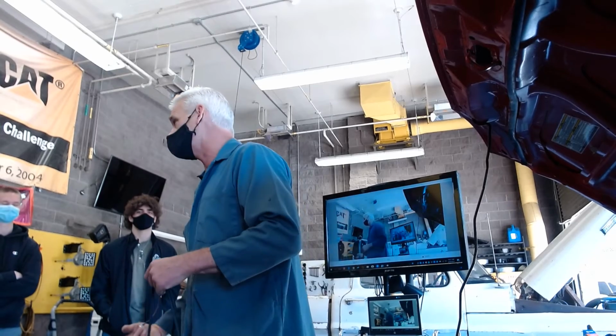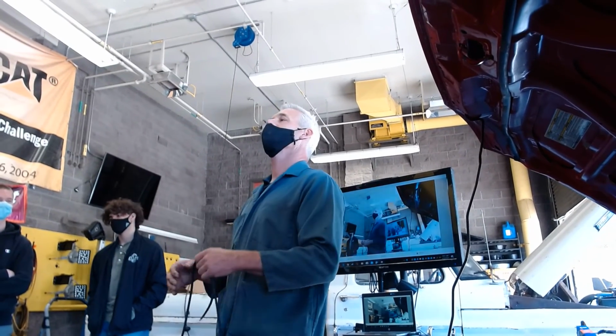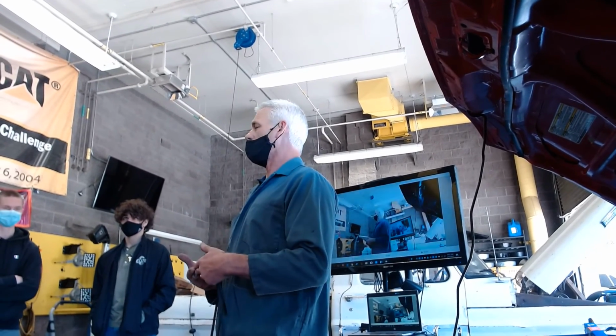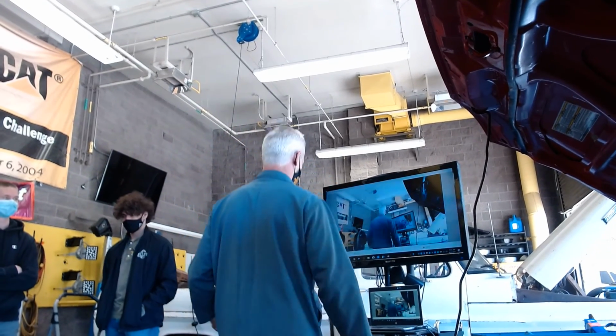It was actually in the harness underneath the intake manifold, but we were able to pull it back and we saw it. I had to disconnect a couple of things. I resoldered the wire together and the car was fixed. Okay, all right, let's stop there.